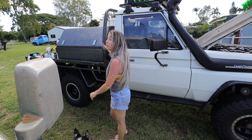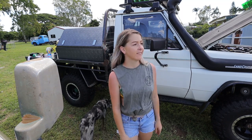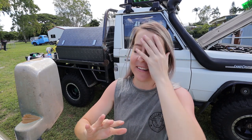So next thing we're going to do is I've got this weld spot that I welded when I lived in Ipswich, so probably like 6-7 years ago. And I just primed it, I never got around to painting it. So I'm going to flapper disc it back, prime it, and then paint it. And it's gonna look dodgy, but it's gonna be better than a big rough spot there.